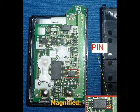Use the electrical tape to cover the three pins above it, because if you touch the safety pin to two other pins, it will short circuit and your PSP will no longer be good. Take the safety pin from the outside of the pin, go under it, and push up until it comes off the green part — the motherboard. You can leave it raised or take it completely off.